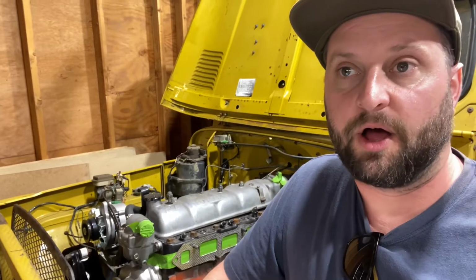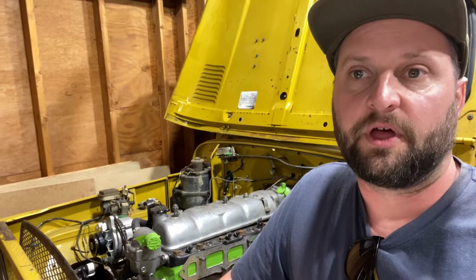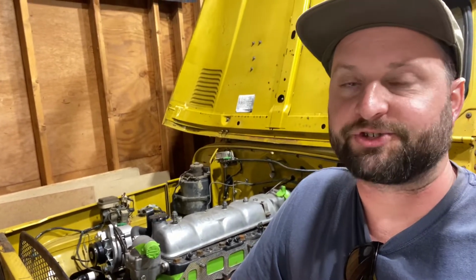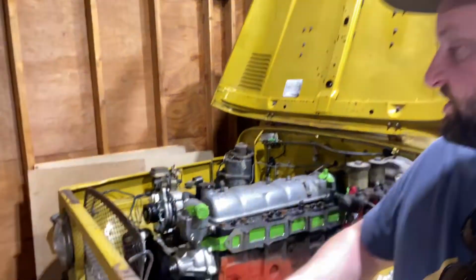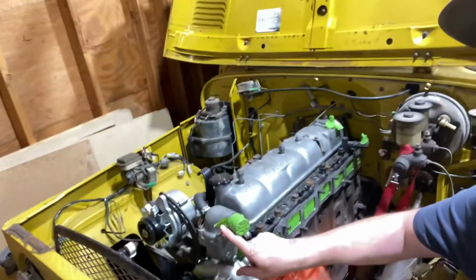1980, as we started using 2Fs in the FJ60, what we saw is lighter connecting rods. So they were forged, but they were also treated during the forging process, where the I-beams along the edges were pounded while they were super hot, which caused strengthening along the outside edge of the I-beam, and they became more resistant to cracking, although they were a lighter assembly. 81, we saw flat-topped pistons, better balancing as they started to put them into the 60 series with higher RPMs, and they changed in 81 to the 4-bolt thermostat housing on the front.